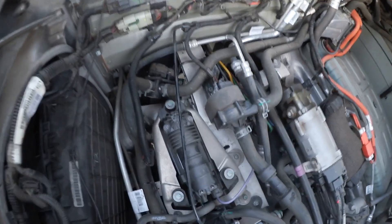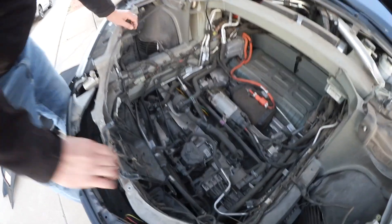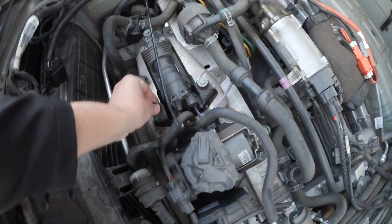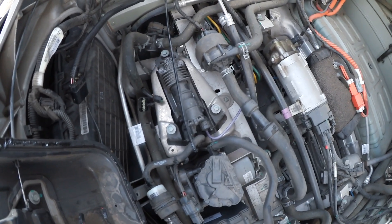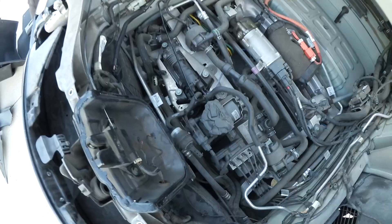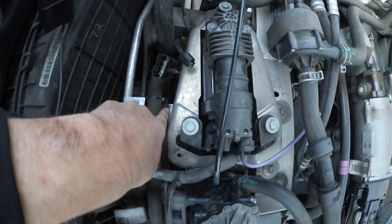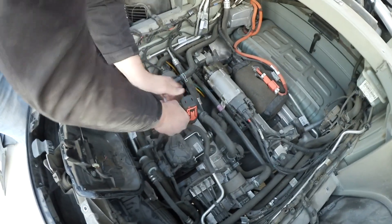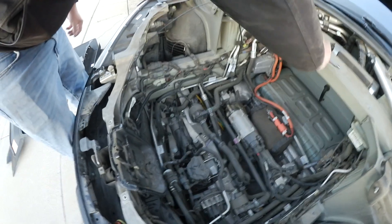There is the pump, and it's in a mount. Here are three bolts and they have been locked down from the other side — they're in rubber, soft — but from the other side you need to get there and take those bolts out so you can take the whole pump assembly off. This whole bracket needs to be removed. There's a bolt from the other side, and that's why you need to get it. We are taking the whole bracket out, removing those bolts first, then taking the entire bracket out with the whole pump, and then loosening the pump out of the bracket.